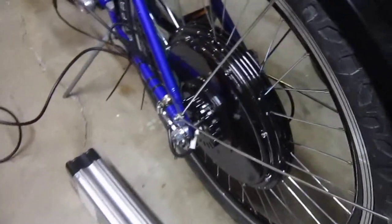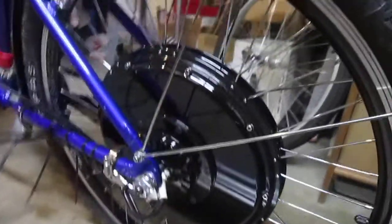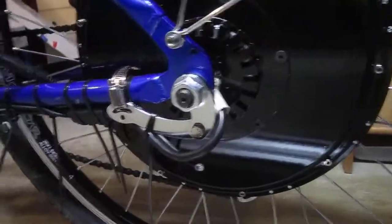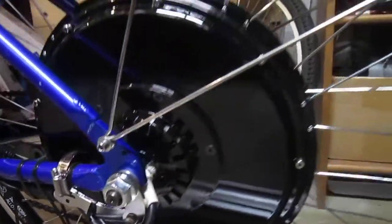So the wheel fit on. It's a thousand, maybe fifteen hundred watts. I was able to get torque arms on both sides. I took a little bit on this side — it was a little tight, but I got everything real nice and smooth there. The motor mounted good and solid, bolts are tight.